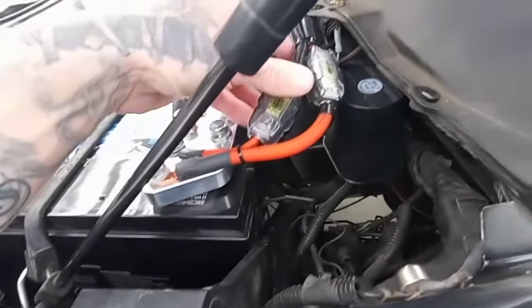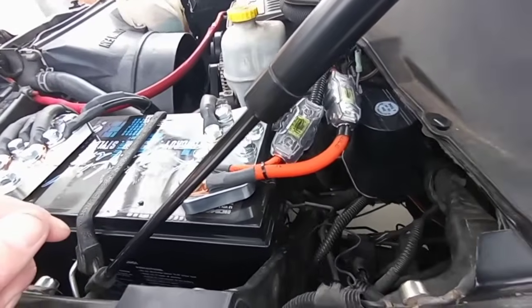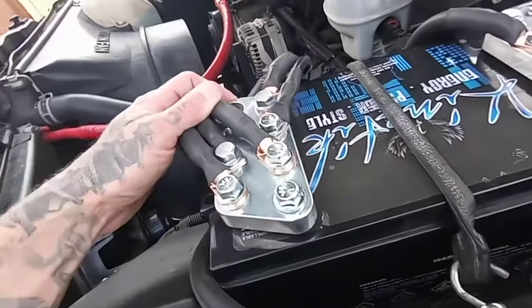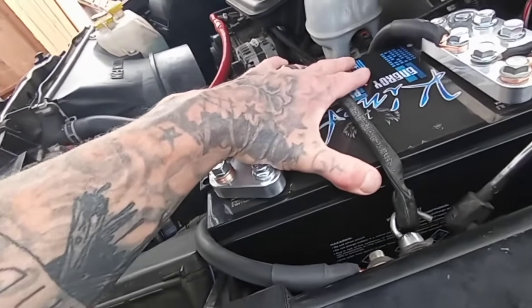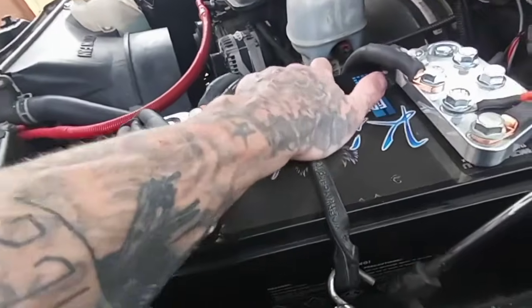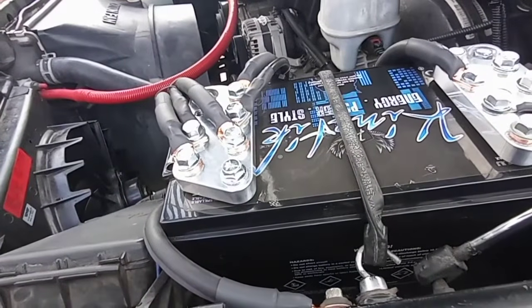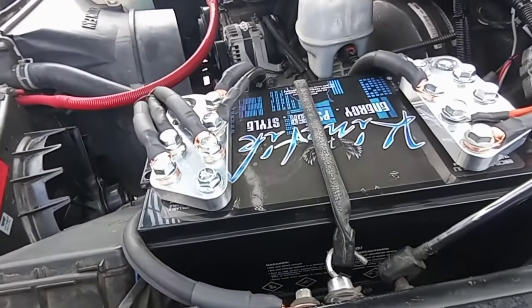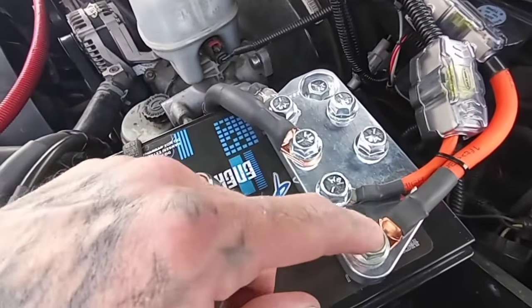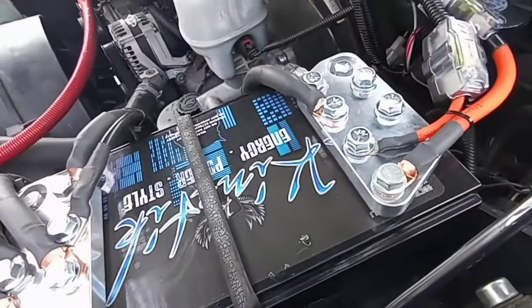I took that thing out that they made. This is cool for now. So I fixed some wires in here because they were exposed. And this didn't have something to tie the battery down. So I did the best with what I got right now. It's pretty stable. I just don't know how long this will last with the heat under the hood. So I'm going to suggest he just go buy a kit from AutoZone. But I wanted to change this terminal. I got lucky, I even had these terminals for this and this. I ran out of shrink tube yesterday. I scrounged up these 2 pieces.